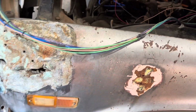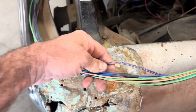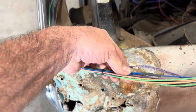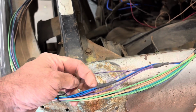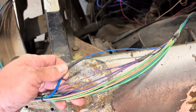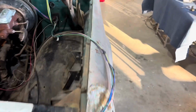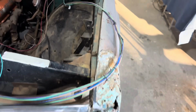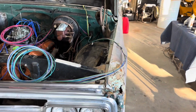And now you've got 4 extra wires out here, and for the purple one, you get 4 just by the purple ones. So it's just extra wiring that doesn't need to be there. You can clean it up just by doing a single wire pass the whole way across. But they do a split way before the actual split should be. Just one of my complaints about the Painless Wiring kit.